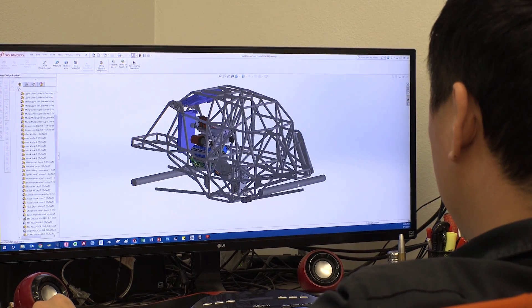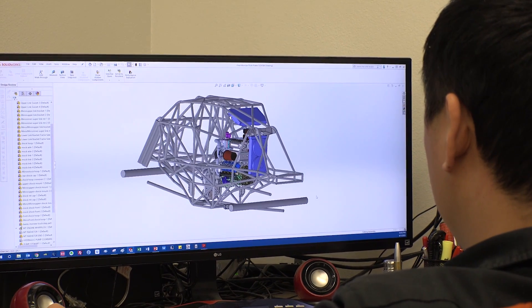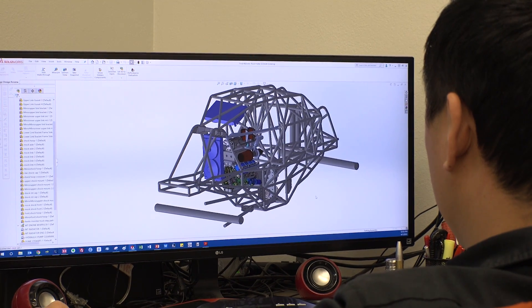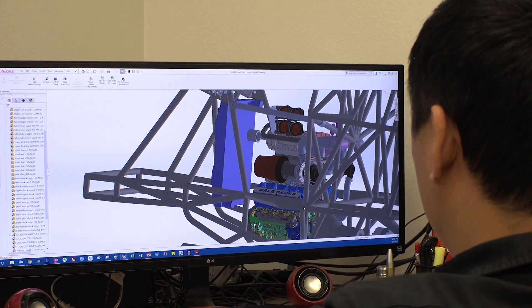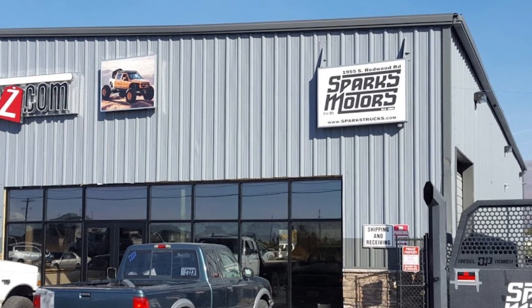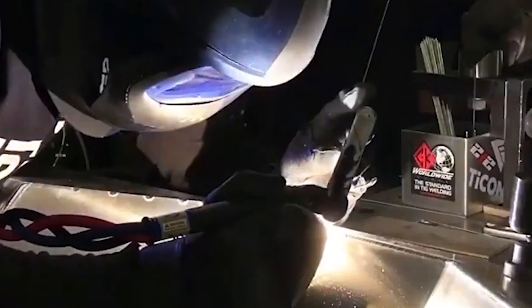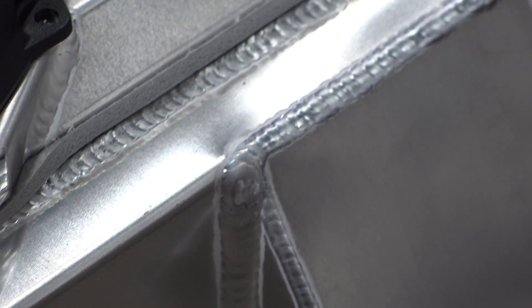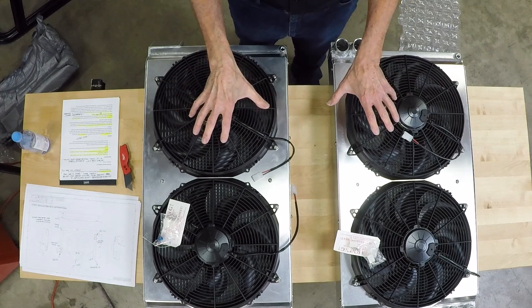The magic of editing. We already had the CAD drawing of the chassis, so in CAD, Joshua installed the engine cooling radiator and the intercooling radiator, and then we plumbed it, ran the hoses, mounted the pumps, and decided where we needed the fittings — in and out for water, temp bungs, drain bungs, fill bungs, all of that stuff. We sent them to Sparks Motors in Utah with the drawings. You guys have probably seen Sparks Motors on Diesel Brothers. Rush Kane over there at Sparks installed beautifully. This guy's got some chops when it comes to fabrication and TIG welding. Rush, you laid down some serious dimes. Beautiful stuff. When Rush was done, he put them back in the box — that's what we just unboxed. These babies are finished and ready to go in the chassis.